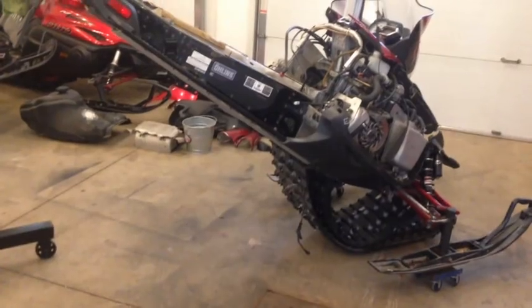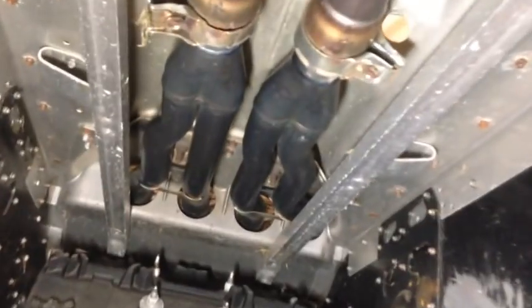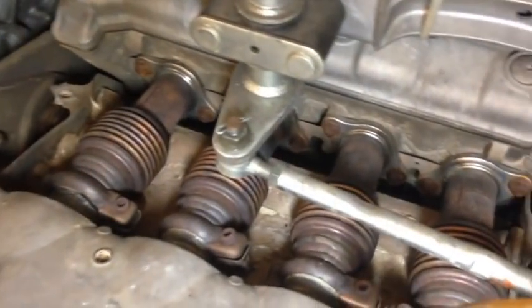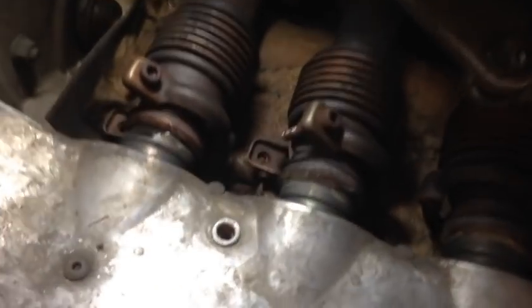go through with you. Alright, our 2007 Apex, we got our suspension out, and now we have access to all the underneath components. So there's your 2 clamps that hold your can pipe to your Y pipes, and all the way forward. There's those brackets. Then we'll get your exhaust out. And same thing, like I said, once we get up the top here, and then we pull your manifold bolts out and stuff. Alright, we got our rivets out, our bolts out of the bracket that holds that on, the Y pipes. As you can see, I got the clamps out. Okay, so now I have all my clamps removed.